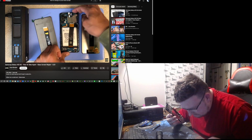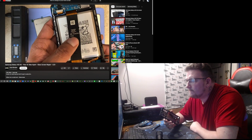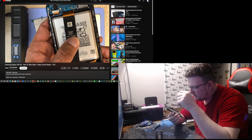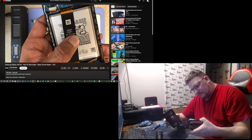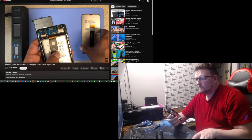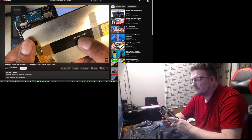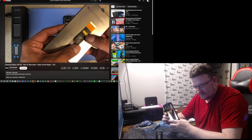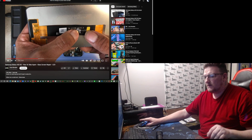You can always identify which one is the one you need. You can go to the cable and you're gonna see A326. And this is the important detail, the letter after the six. This is U. So you guys can see in the new LCD I ordered, A326U. All right, that's perfect. On the other one that I ordered previously, A326B.